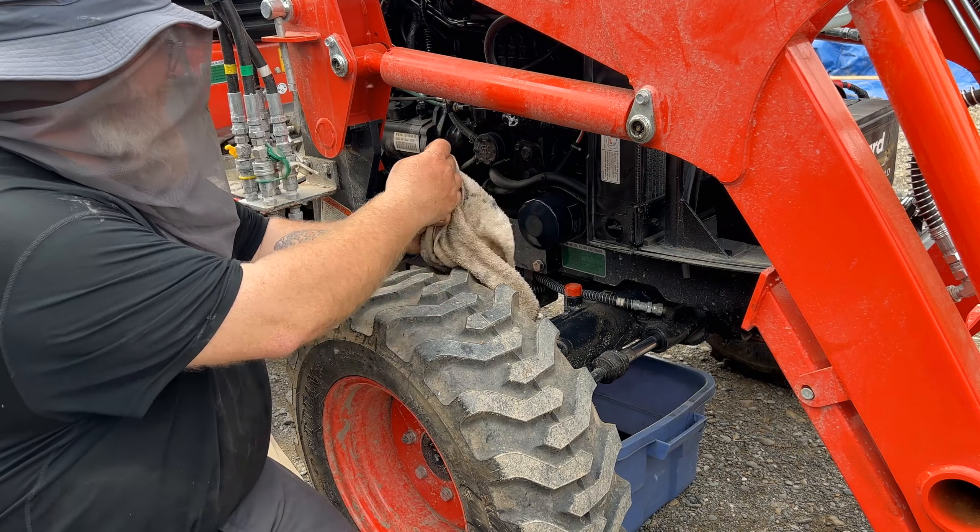The oil cap where we're going to be adding oil is under the hood — that is surprisingly tight. We're going to go ahead and take the cap off. All right, we've got the cap off. We've got our funnel in and we're ready to add oil. This particular motor takes six quarts of oil, and the type of oil we're adding is Mobil synthetic heavy-duty diesel engine oil 15W-40. With six quarts to add, we're going to add a gallon and a half.